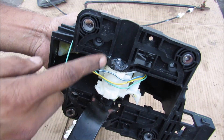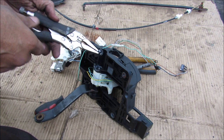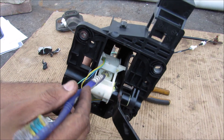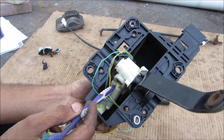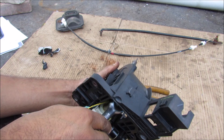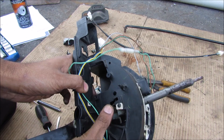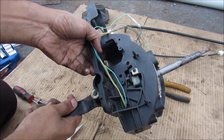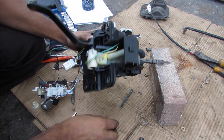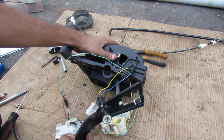There's a little lock washer here that holds the pivot for the main arm. I'm going to remove this little washer and the vise grip — and there's the center pivot bolt. The shifter also has a secondary pivot point for the little guide that shifts it over into sport mode. There's a 10mm nut there to remove, and then remove this little pivot bolt over here. This cross brace was preventing the whole unit from coming out, so I just hit it out with a hammer — and here's the cross brace. With that out of the way, I can remove the shifter controller.